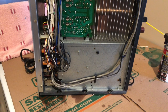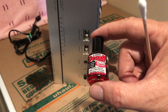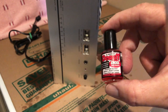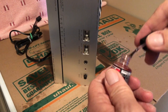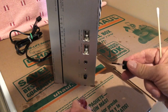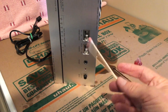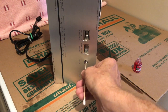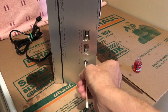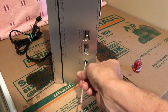That takes care of the front. Now for the headphone jack and some of the connections on the back, I have this little bottle similar to DeoxIT D5 that comes with a brush. I'll put some on the inside, work it around, maybe use a Q-tip as well. There might be dust and debris in there that we want to work out. It's good for metal-to-metal surfaces, then we'll clean it up and do something similar to the RCA connectors on the back.